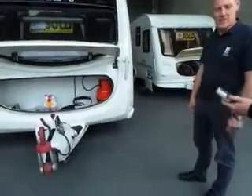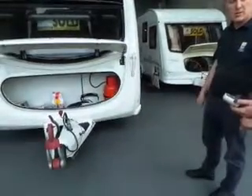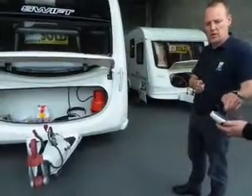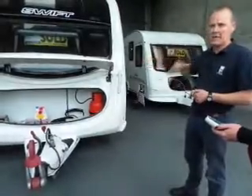When you're finished, always make sure you take the starter key out — always take that out. It can shut itself out sometimes; if you hit the orange button or the on/off buttons by mistake, it can lock itself out. All you need to do is turn the key, take it out, give it a few seconds, put it back in and it'll reset.